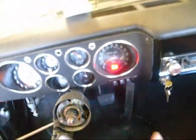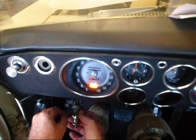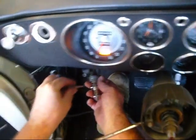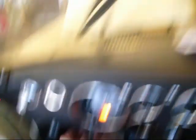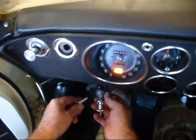To test it, you've got to ground your circuit. There's a nice ground spot on there. When I turn the knob and touch the ground - I've got to scrape that up to get to some solid metal. Now you see, the windshield wipers are working because I've grounded it. Now I know this switch works.